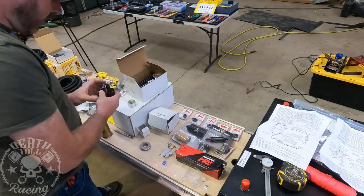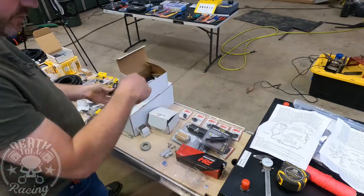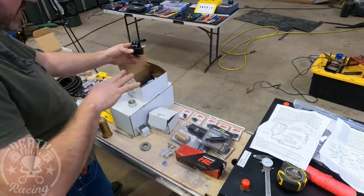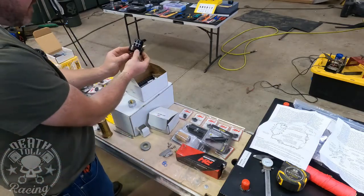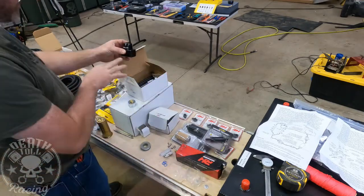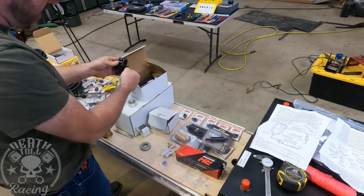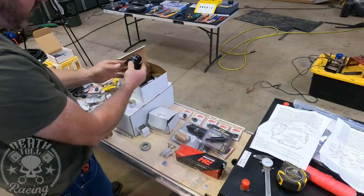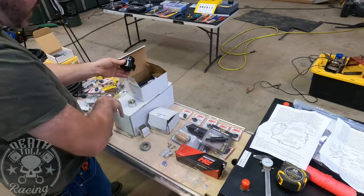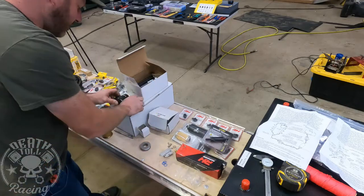Okay, so we have to assemble our fuel pressure regulator. This is a little bit odd. Normally, you would run it through your injectors and then regulate afterwards. So your pressure would be going into your injectors, and then into either side of here, and then the outlet going back to the tank. So your fuel pump to the beginning of your injectors, after your injectors into the regulator in and out. We can't do it that way. So we're going to have to just run an inlet in and an outlet to our secondary fuel pump, the injection pump, and then this is again the return line. So in and out, or it could be in and out. Either way, that's out.